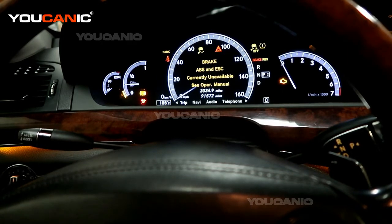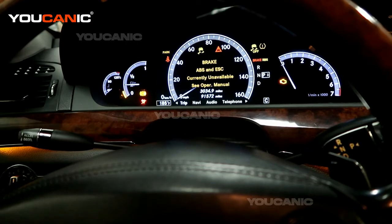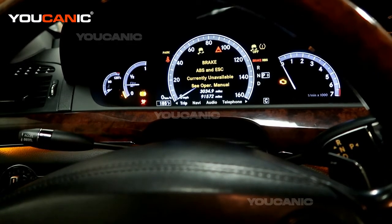Remember these vehicles today have more than one control unit. The main one is the one that diagnoses the engine, and that's what triggers the check engine light when there is an issue that's critical for the engine, the emission system, or in some cases if it detects a serious issue with the transmission. So if any of those systems fail and trigger a code, you'll be able to read it, find out what code that is, and clear it once you fix the issue.